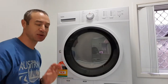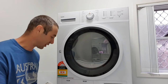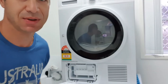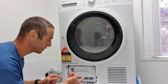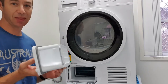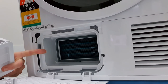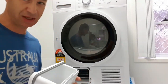This filter will be full after every operation. There's a second filter — the machine will give a warning when it's due — but I recommend cleaning it every time, because this filter is the most important one. To open it, bring down the two levers and it all opens up. There's a chamber with the filter inside. Two hooks — one comes up and one comes down — and then you withdraw the whole section. It looks like a little radiator or heat sink, just like in an air conditioner or car.